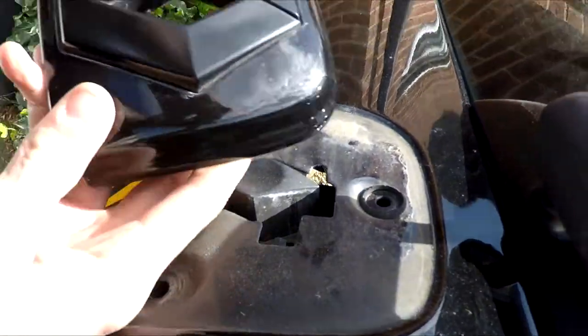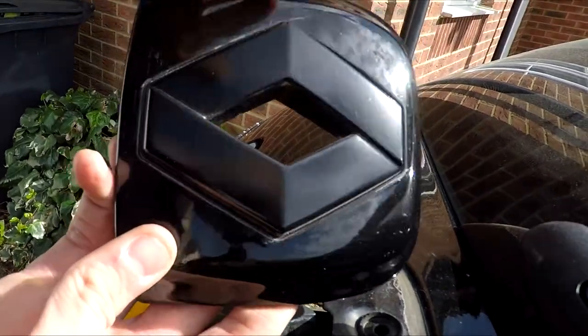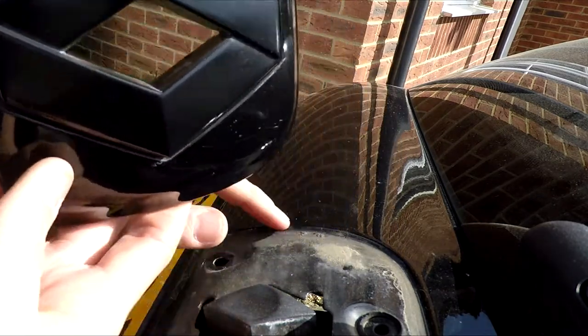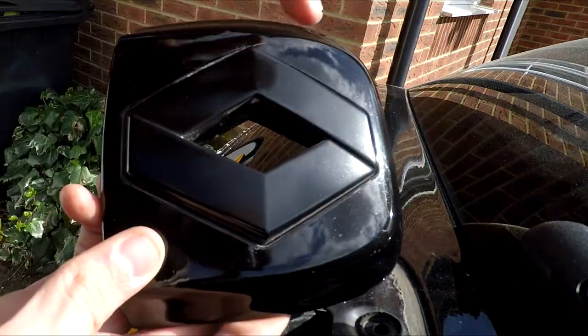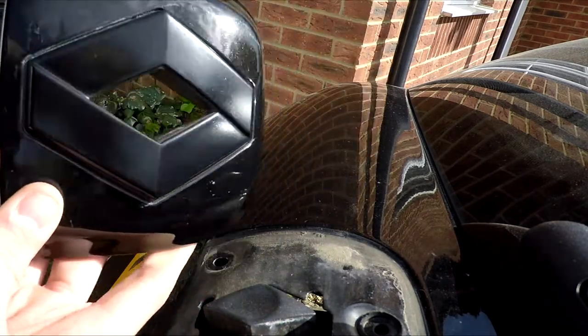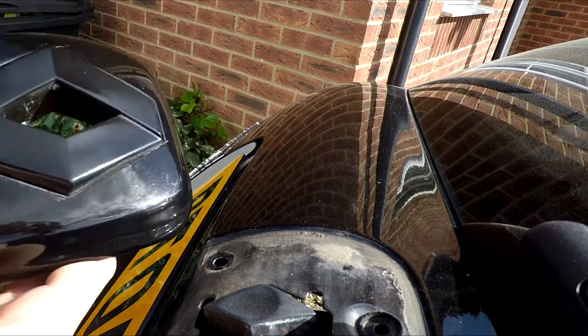She's now off. That's the best way I've found to get the back badge off - that's how I took mine off to get it sprayed black. I surrounded it with newspaper and masking tape, which seemed to work pretty well. In my opinion it was better than doing it on the car, because then I only had to cover the boot catch area rather than the whole back of the car.